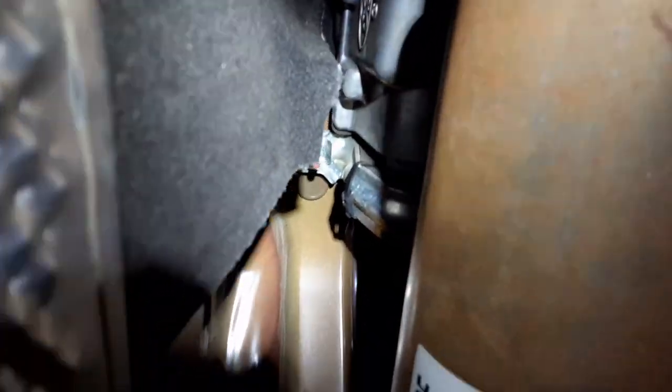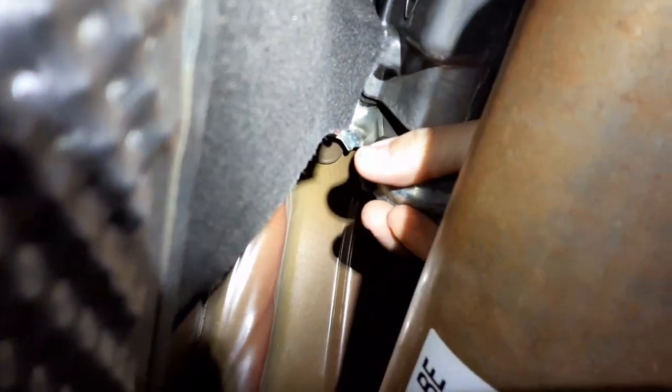It's really hard to hold a headlamp and film for y'all, but there's a 10mm there and a 10mm there. Two long extensions, and the bolts will pop right out. So stay tuned while I do that, and we'll see what the next step is. Okay, so our two bolts are out now, which gives us access to this stamped steel bracket right here, and we're just going to see how this comes out of there. I'm assuming it just pulls in a downward direction.